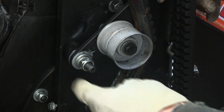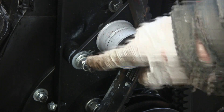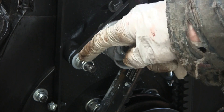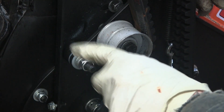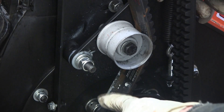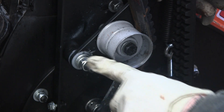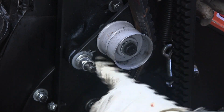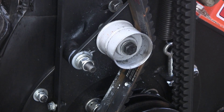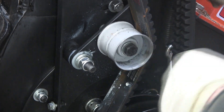They've got a nylock nut here, but there's also a lock washer behind it. I'm guessing they're using that to press it in so it doesn't wobble around. I'm going to take this nut off when I go to the hardware store tomorrow, take off that lock washer, get a 10 millimeter straight nut, tighten it on, and then tighten the nylock nut down on top of it and cinch them together — because there's just too much give in this thing.